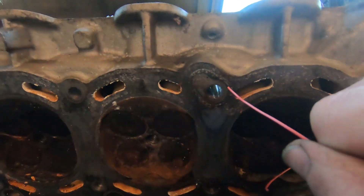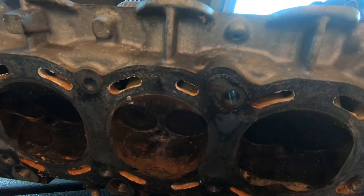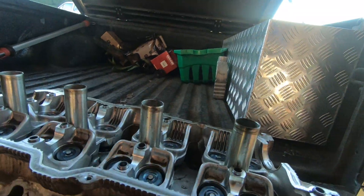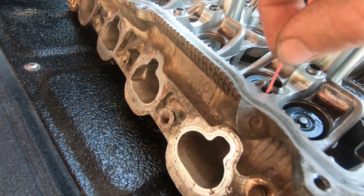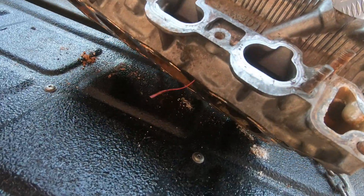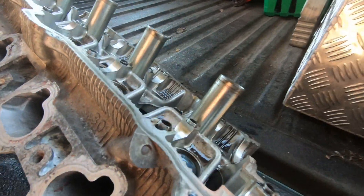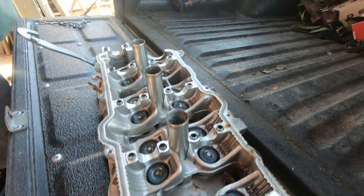For the cylinder head, it goes up here. There's a drilling halfway up which relates to this piece here on the cylinder head. Comes up, and here's our hole here down to that drilling. There we go — look at that, there it is. Here's our gallery, and it's got this little tube that runs over here to feed oil through the cylinder head.